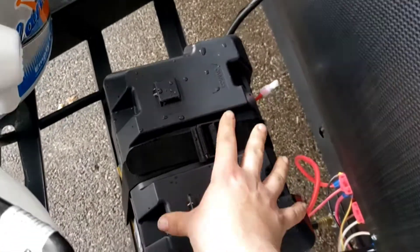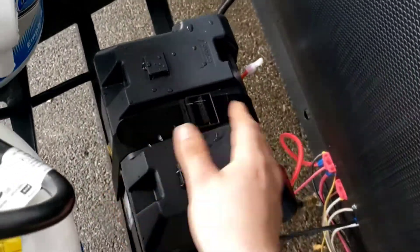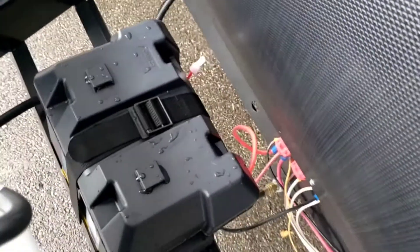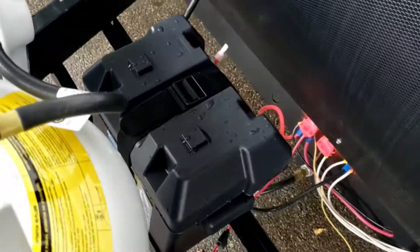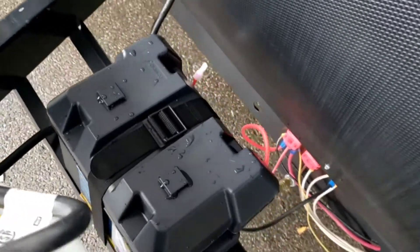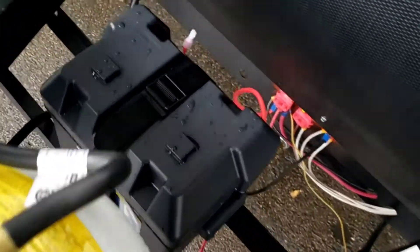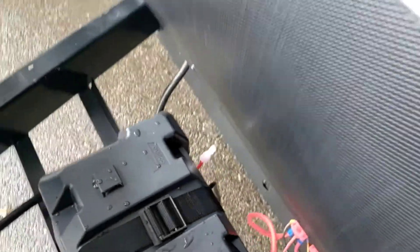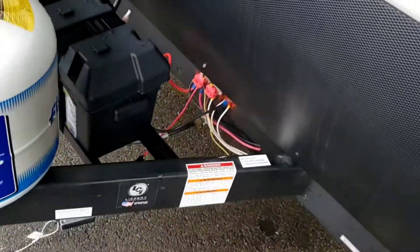Group 24 RV Marine Grade Battery — it's a brand new battery. In the winter I recommend taking your battery completely out and storing it somewhere warmer, like your garage or basement, rather than just sitting outside all winter. And if it's going to be a long time between trips, I recommend disconnecting the negative lead off your battery to keep anything from using it while you're away.